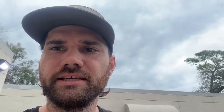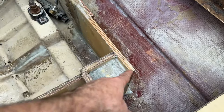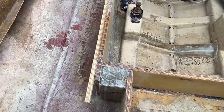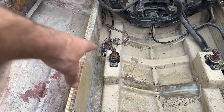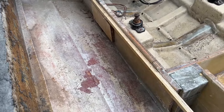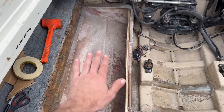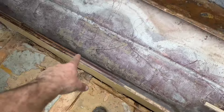Let me turn the camera around and make it easier. So we've got a new build side here — got that rotten wood replaced, that was all up at the end. The boards towards the back are looking really good, they're pretty structurally sound. Same thing over here. I had to cut back a bit further because a lot of this was rotted, and that's all squared away now. All fresh wood in there, fiberglassed in. And you can see I've got my pedestal — I still have to nip this one down, but that's the pedestal where the floor will be sitting. I've already got that fitted up — fits great.